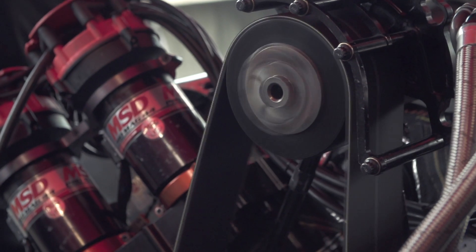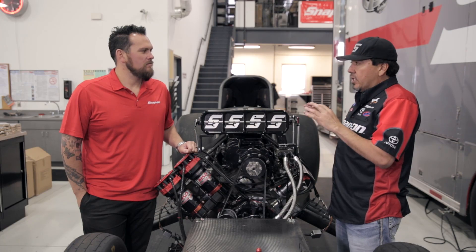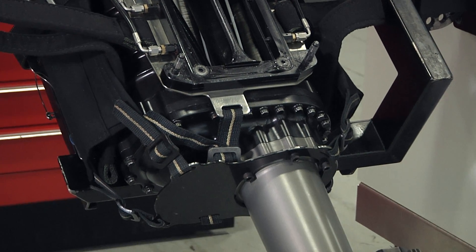This blower is a fine-tuned ported piece of equipment. The rotors are made out of billet aluminum, the housing is made out of billet aluminum, so there's a lot of fine tuning that goes into this. This blower is really the key to winning races. Some people call them windmakers. I would say it accounts for three or four thousand horsepower on this Nitro engine.